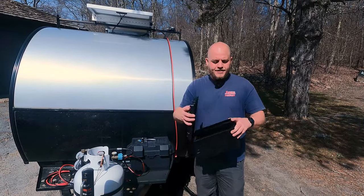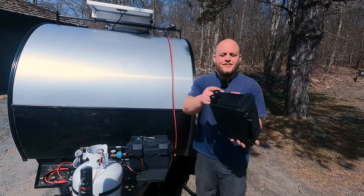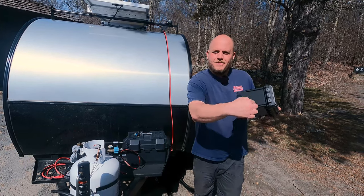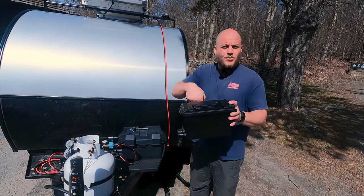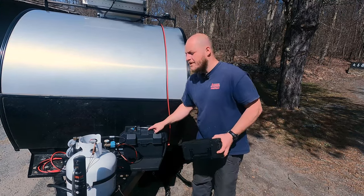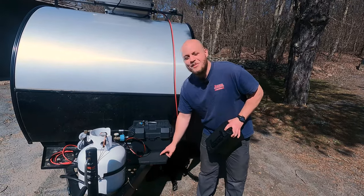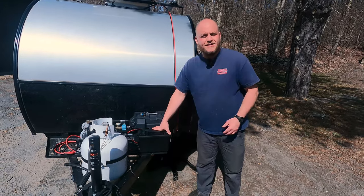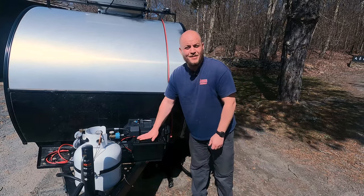Now it's time to install the box. You don't have to worry about a high-quality Pelican box — I go with something very cheap. I did install a couple of cable glands since I had them on a shelf, but some people just cut a big hole in the bottom of the box. That's fine — we have a waterproof controller, so you can drill a hole through the bottom so any water that comes in can drain out, very similar to a battery box. To make my job easier I put a little piece of wood, screwed it down on the platform, and I'm going to screw this box into that piece of wood with just a couple of screws.